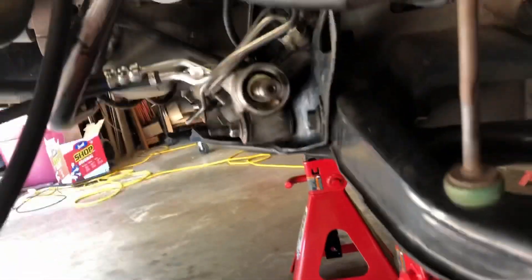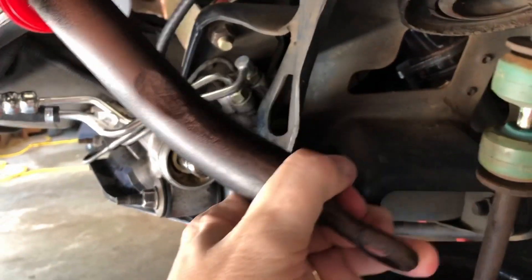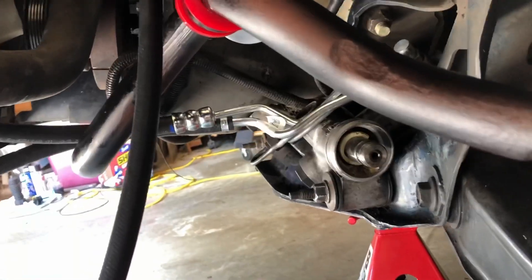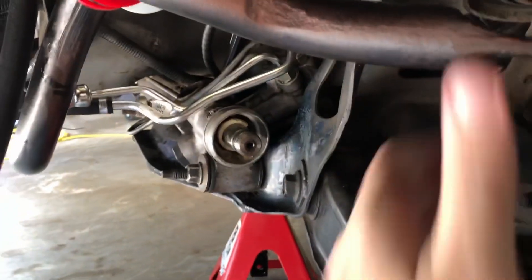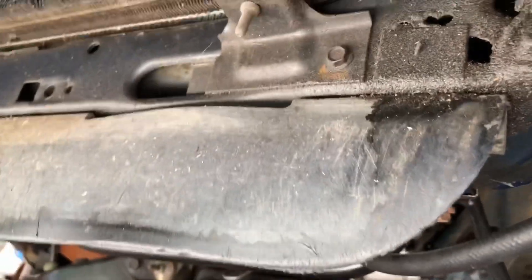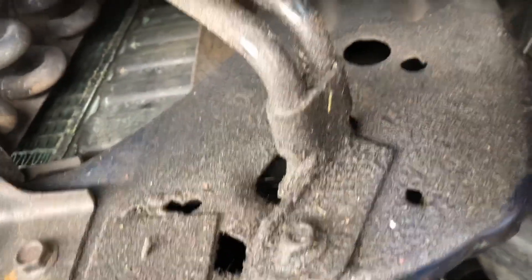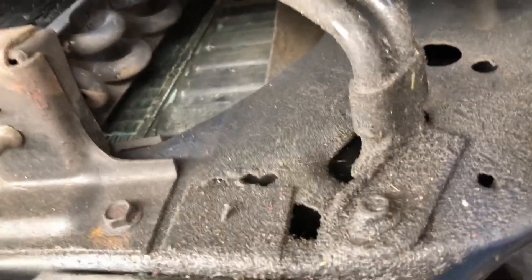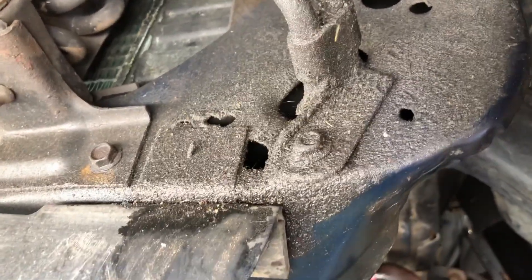I confess I did have them underneath the sway bar because I had the sway bar disconnected and pulled way down out of the way, so I wasn't paying attention. I had to disconnect one and reroute it over the sway bar. All we have left is the two hoses that connect to the cooler. But I'm adding to my scope of work here — all of this area is really gunked up and even the cooler lines have a lot of buildup on them. So I'm actually going to remove the cooler and clean all of this, then put it back. It's very simple — basically just two little 5/16ths bolts.